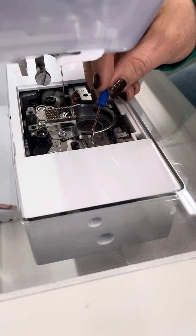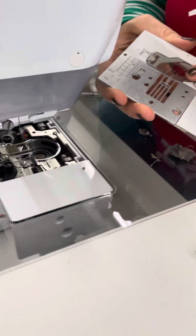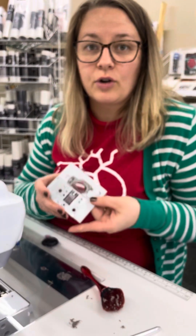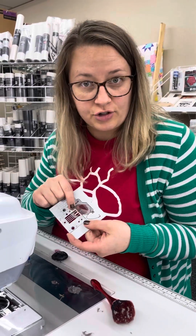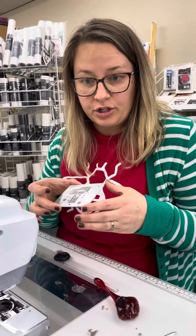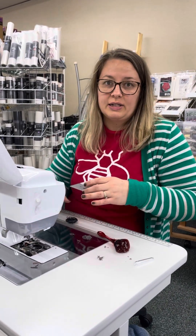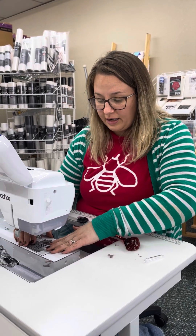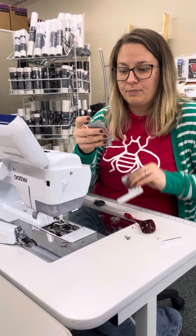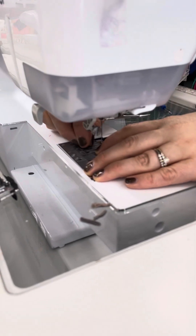I notice there's still a yellow thread trapped in there near that blade. We had a customer whose machine — a new 3100 — wouldn't let her do zigzags because it thought the straight stitch needle plate was on, even though she had the correct foot on. That's because there's a sensor deep in the machine that tells it which needle plate is installed. Even though her bobbin case was clean, there was so much other lint inside that the machine couldn't read that sensor, so it was time for a full cleaning.